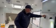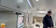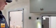So just flick this little switch here, and in a few seconds, wait a sec. So the inverter is separate from the 12-volt operating system that's operating most things in the caravan? Yes. This is only going to operate things like your microwave. So when we turn that on, you heard that little beep. That was your microwave turning on. So that is currently running on your batteries at the moment through the inverter, which is great.